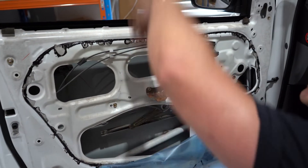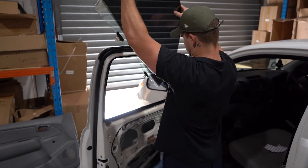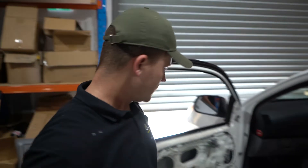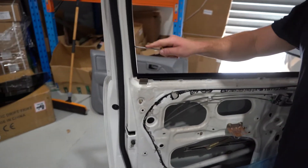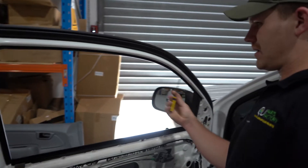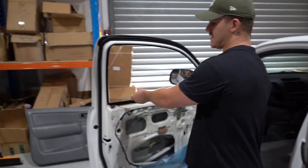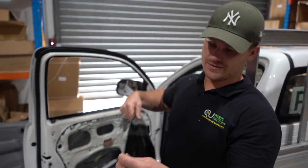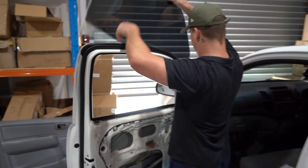At this point we're ready to drop the glass into the door. I'm going to bring it over the top of the door like so. But before we do that, we're actually going to clean out the rubber seal of the remaining parts of our old door glass — literally just get your screwdriver and run it around the edges. There's going to be a lot but don't be afraid to get a bit messy. If you don't do that, a little bit of glass at the top could press on the new glass wrong and you're back where you started — broken again. So definitely clean it out properly.